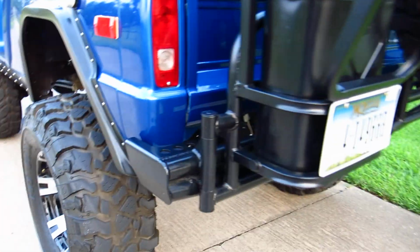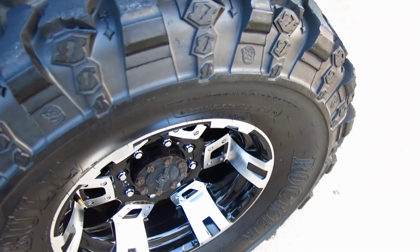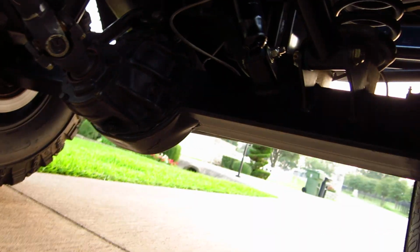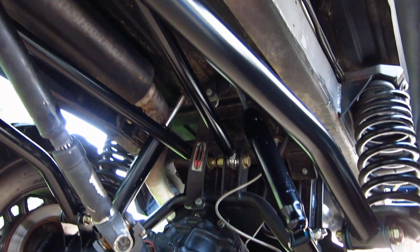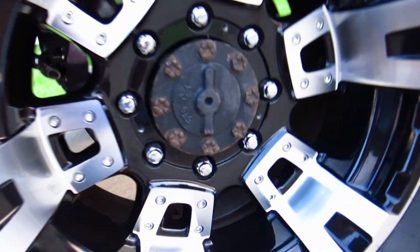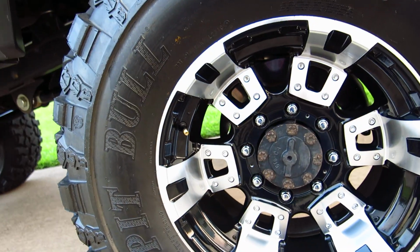It's got a lot of cool modifications. To begin with, underneath you'll notice you've got 8 lug axles, and these Broncos came with 9-inch rear ends with a 5 on 5.5 bolt pattern. Well, this one's been modified to a coil rear suspension and a really beefy housing. It's a square tubing like you'd see on a Rockwell, but it's a 4-link suspension, stainless steel brake lines, disc brakes, giant Heim joints, and basically they took this apart and did a full build on it.